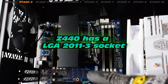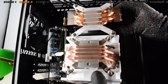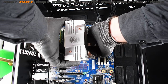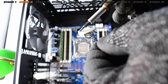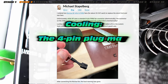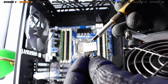I'll pull it off just because you asked nicely. This is the Cooler Master Hyper 212 — but much to my dismay it is the white edition, which doesn't support this LGA socket. Definitely check that before you buy them and plan well ahead of time. In my case I got caught out — it fits the Z240 but does not fit the Z440. For demo purposes it would look really good, but anyway, you can fit an aftermarket cooler. You will need a power adapter though — this is HP's proprietary cable. Normally your CPU fan has four pins, but in this case we need an adapter. You also have to notch these — the HP plug has two little standoff keys on the sides in different locations, so sometimes you have to trim one off.